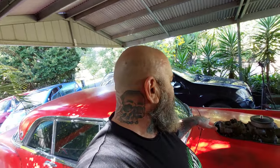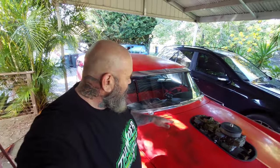But when I just had the fuel pump on initially, I'm sure it was on long enough to fill the bowl, I had it pretty good. Now I've got an extra, probably a good turn or more onto that nut since where I had it first set. So it was set pretty good. Then it seemed to all of a sudden, it was like it started to bypass the needle and seat.